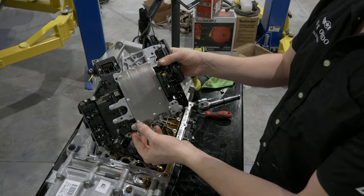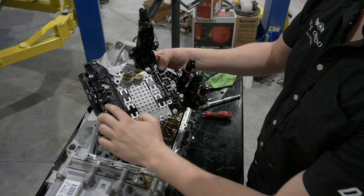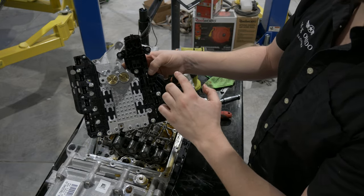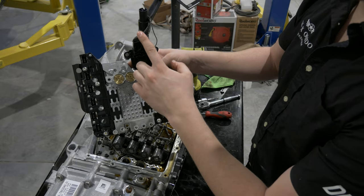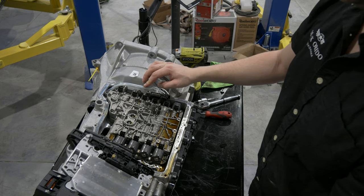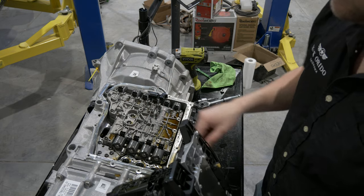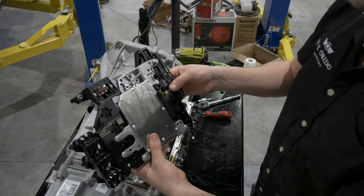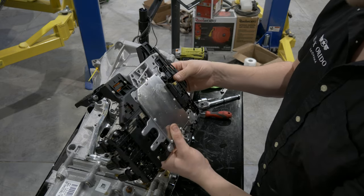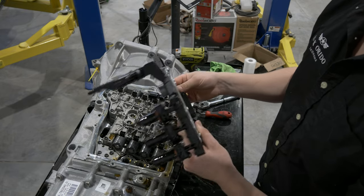Okay, we have the mechatronics out. I'll give a little breakdown of what each piece is. These are two pressure sensors. These are the solenoid power plugs. These are shift fork position sensors. This is the RPM sensor. And then in the front, you have a temperature and RPM sensor. And these are all the solenoids. The shift forks are under here, which will go back and forth. Basically, you can just brake clean this off so it's not too soupy, and put it in a box to ship to us. We're going to take a few more things out and add them to that box before we're done here today.